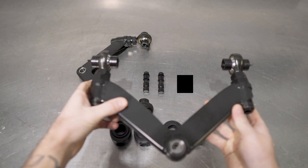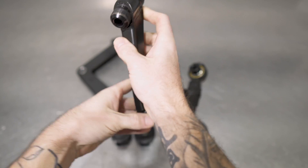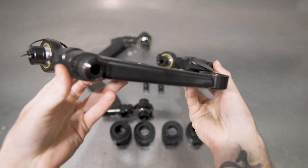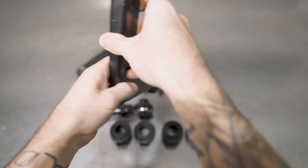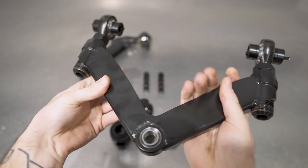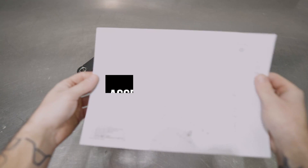Next you have the FUKAS arm itself, which is currently being tilted and twisted for your viewing pleasure. It comes with some goodies, including stackable shims to adjust the caster for all you geometry nerds out there, as well as the added luxury of on-car adjustment. The dude that aligns your car may or may not give you a high five for this one, so thank us later. The bearings themselves are also replaceable for service or if you smack a curb.